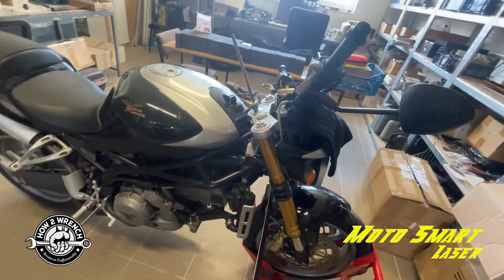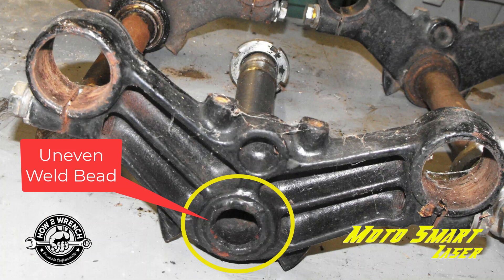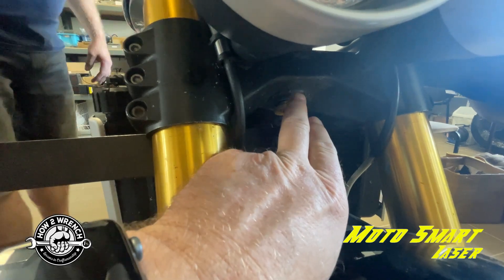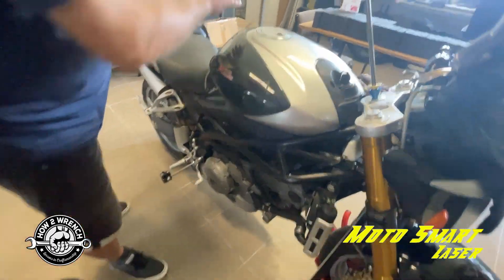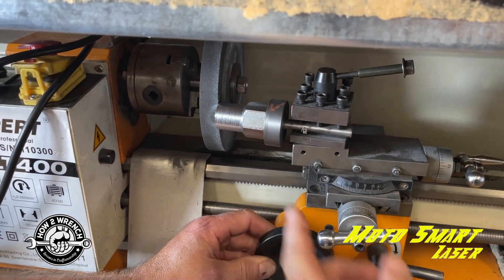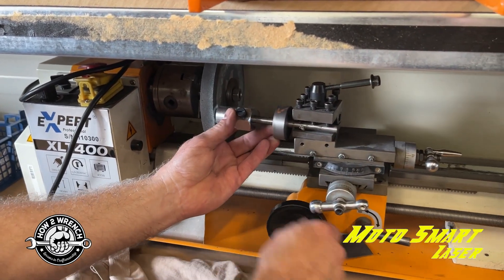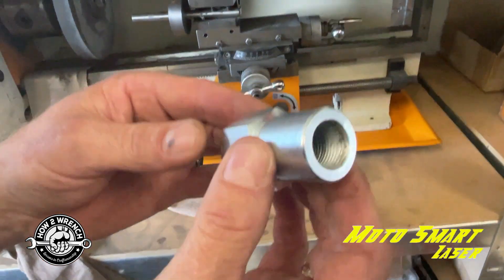Let's look at the front setup we already have here. We have the shaft through the triple tree and the scale is sideways. One point he made: don't just try and throw these in — you want to get under there and make sure there's not a weld across it that won't allow you to center it up. This won't work on every model in the world, but in this case where it was machined through on both sides, we had two good surfaces to get cones on. Then we have our scale. He's showing me what kind of detail goes into manufacturing — these nuts that you could thread on if you didn't have a hole through are literally surface-ground on a little lathe setup, so it's very specific. You can actually see how that surface is ground — if you drop it, you can't use it anymore.